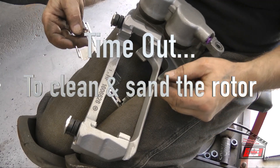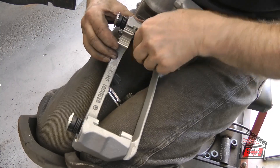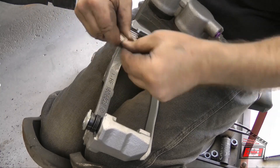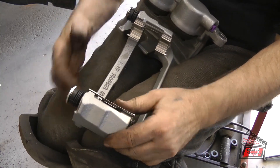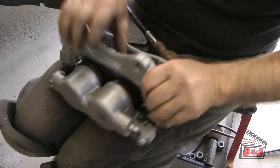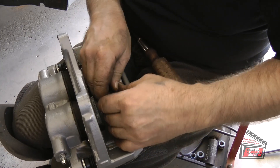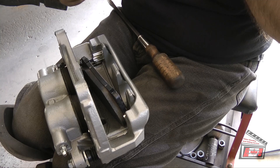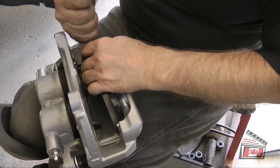Let's start getting this assembled again. Anti-rattle spring — put one on here, one on there. There we go. Two anti-rattle springs in, that side won't be rattling. Now let's put the other pad in. Ow! Now I know where I'm getting those slivers from — they come out of the brake pads. All the little metal garbage swept off the floor and put in the brake pads. Very small slivers but you can really feel them.